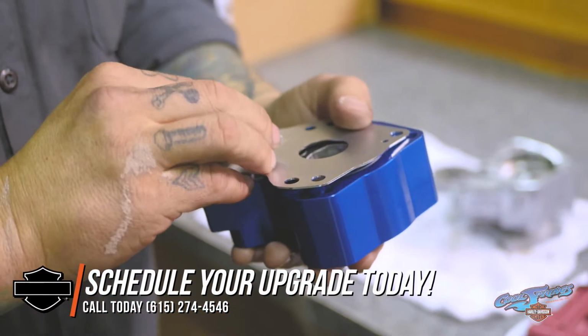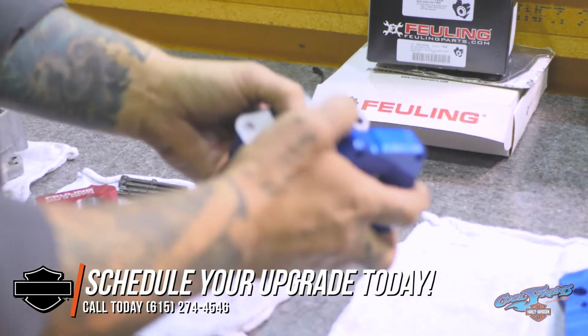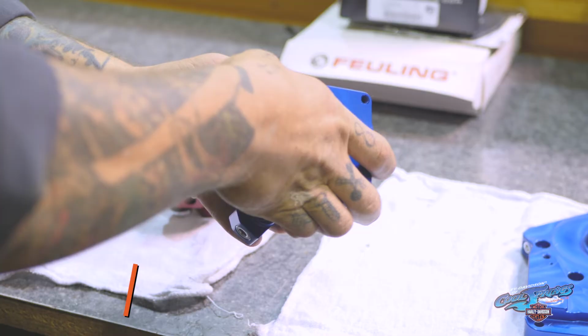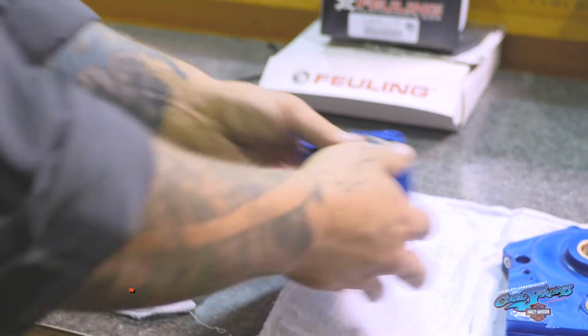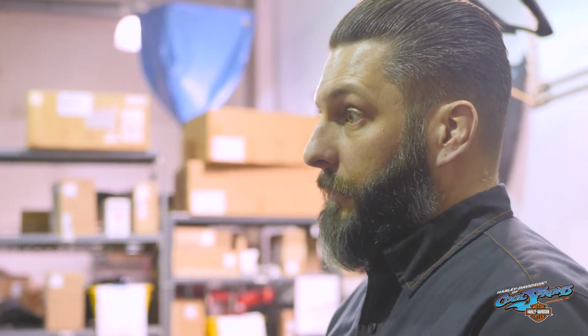And we had somebody getting us retail numbers. The S&S setup, cam plate and oil pump, is also, I believe, over $100 cheaper than the Feuling setup retail. And it was delivered with the tensioner block-off plate. For the Feuling, you're paying separately for the cam block-off plate and the tensioner block-off plate. So if you're going to run a gear drive cam, you've got to run the block-off plate, or else you'll be wasting all your oil pressure going to nothing.